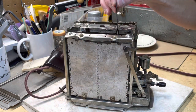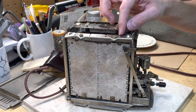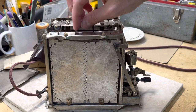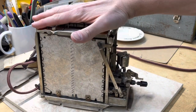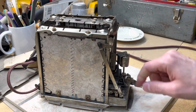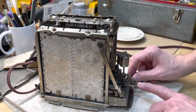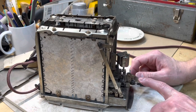Just pop one of those down and let it sit in place - we'll go through and do the rest of those. Do not tip this over, because if these come back out it's going to be a mess. Before we put the chrome lid back on, test and make sure that the toaster mechanism clicks at the bottom and that you have everything in place. Of course it's unplugged now - hold this and just push in here to release, and make sure that the arms go up and down without any interruption.